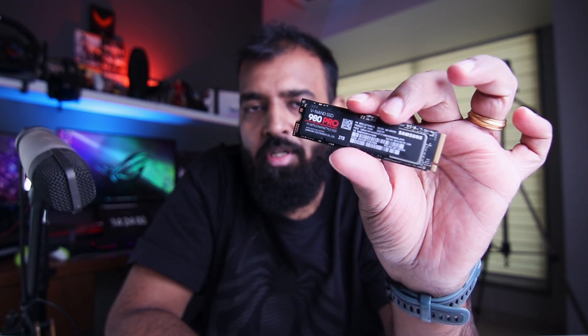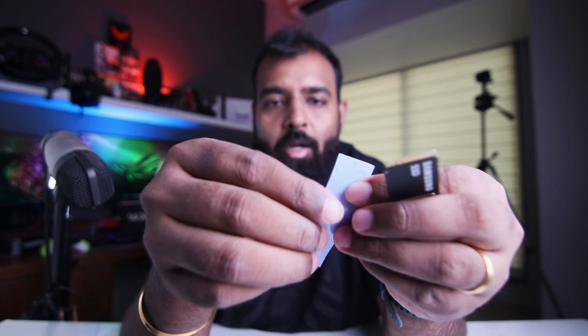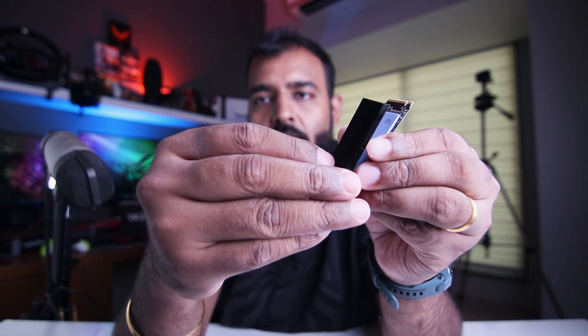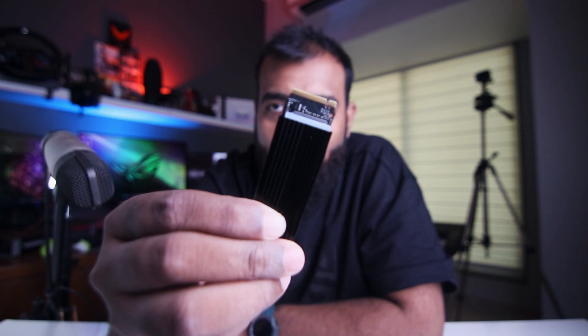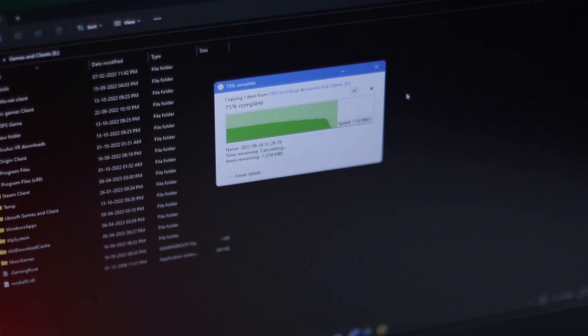This is the M.2 drive I got for my games — a Samsung 980 Pro. I'm going to put this drive in the enclosure and transfer some data from my older hard drive to this drive. This is the thermal pad that you get inside the box. It comes with a protective layer on both sides. You just peel the protective layer off and stick that part on the side of your NVMe. Once you've taken the top protective layer off, you stick the heatsink on the drive. It's completely fine to use the NVMe drive in the enclosure without the thermals, as these drives don't heat up that much.